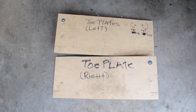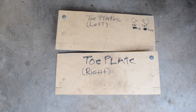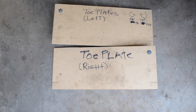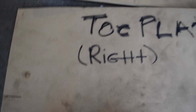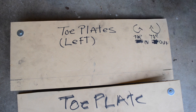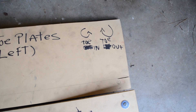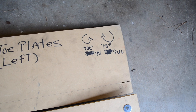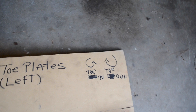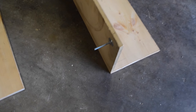The toe plates are relatively simple. They're made from MDF board as thick as possible — I think these are about an inch thick. There are slots cut into the board that are consistent on all the boards; all the boards are exactly the same. These slots allow you to have a consistent height above the floor where you can put your tape measure in, and you're measuring the distance between the two wheels in the front and in the back, and that allows you to see the difference between toe in and toe out. I've also marked on here what direction to turn things under my car — the adjustment for the tie rod in order to make toe out or toe in — that helps me understand things. Once you start doing it, you'll see why having that marked helps you understand what's going on.